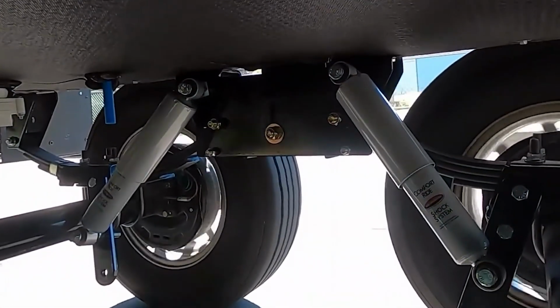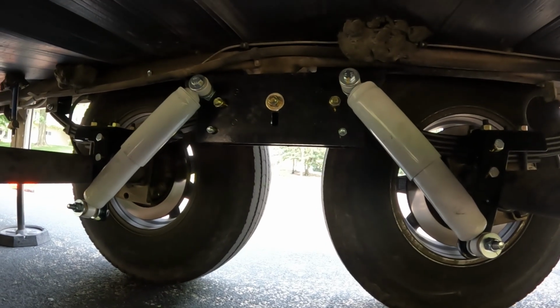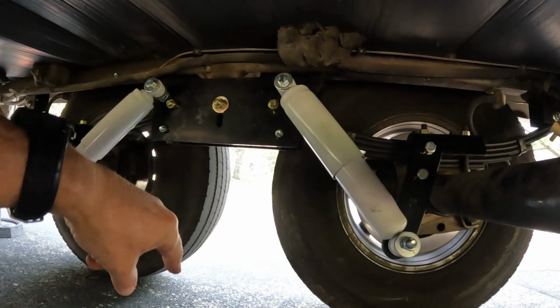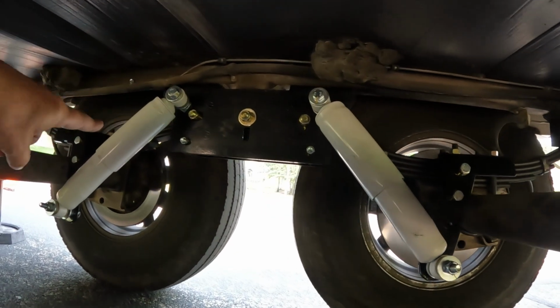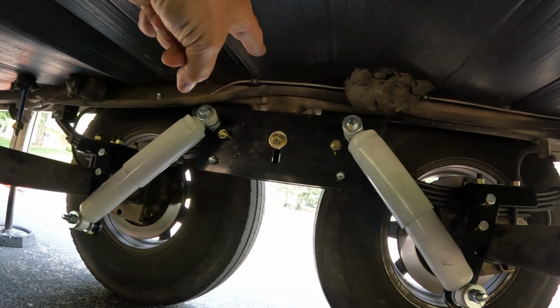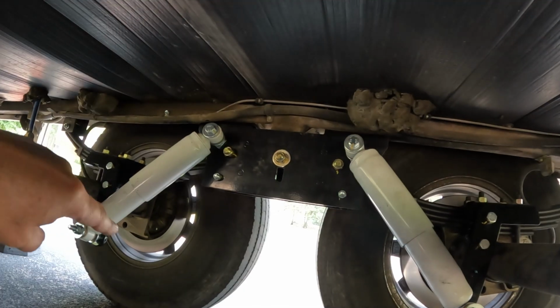That we are. And we just finished one of the biggest upgrades that we've done on our RV. What we did was we switched over to Roadmaster slipper springs and MORryde shocks. This is the view underneath with everything all installed. And we got the shocks in on the supports for them. The slipper springs up there. No equalizer in the middle anymore. That just avoids transferring energy from one shock to the other and back and forth as it goes over bumps.